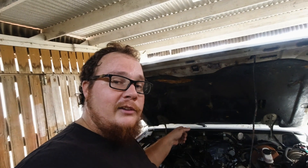What I found wrong that we still need to order for this car: a bad radiator, as you saw, and two rear wheel brake cylinders. Since we're going back in, we're gonna put everything new — brake shoes, wheel cylinder, and spring kit. If you want to see more about this classic Explorer, let me know down in the comments and I'll make it happen. Thank you so much for watching — this was the classic Explorer, peace boys, take care!